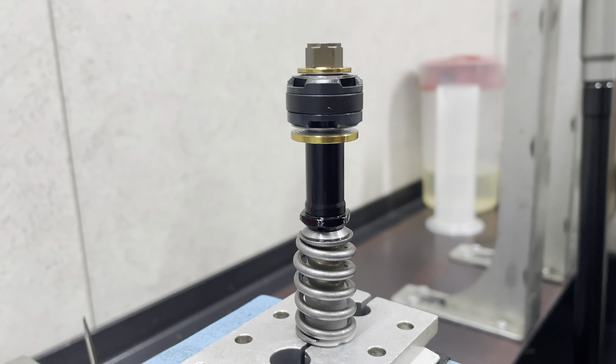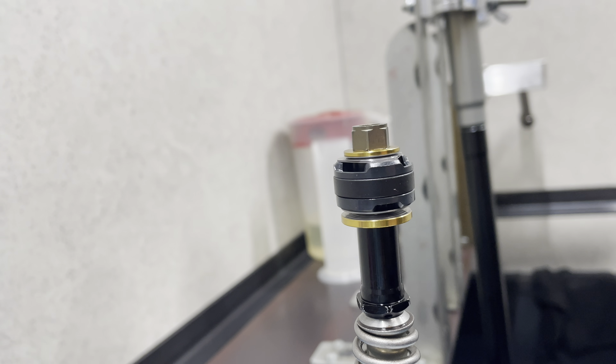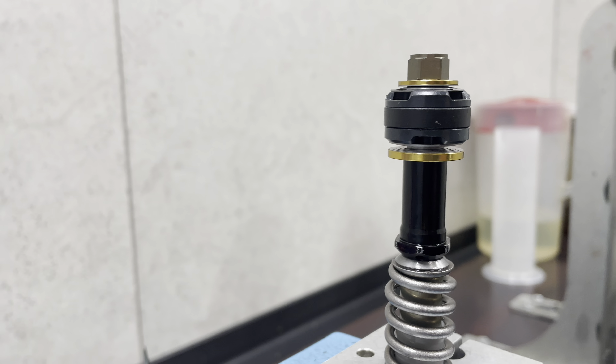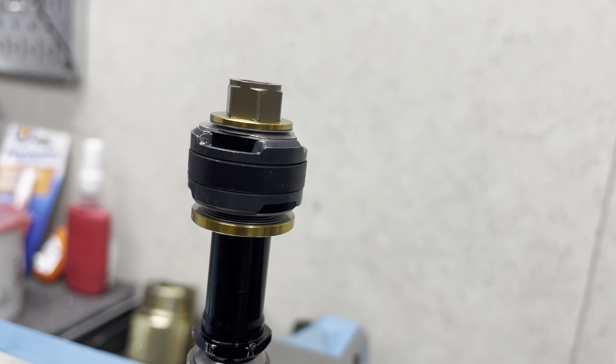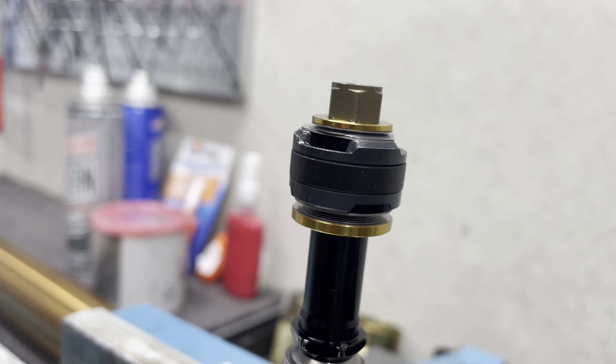The leaf spring mid valve is a very popular style of mid valve for many reasons. It performs well, it has low inertia — think very small weight of moving parts. It is highly responsive and it is highly tunable as well, just using shims.